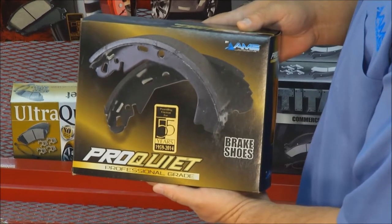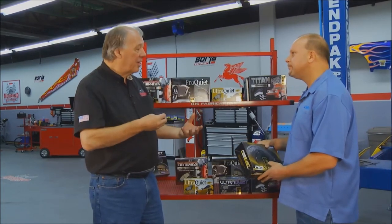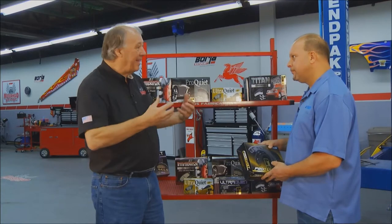It's interesting about this parking brake — a lot of people don't use it very often. Consequently, they kind of get rusted up, then they get frozen up, and then they won't work at all. Especially with these drum brakes, if you let it go they can be a problem. Eventually they do wear out and you've got to replace them, and especially if you've left the thing on partially, it doesn't take long to burn one up.